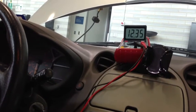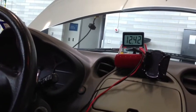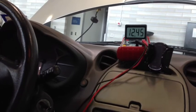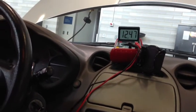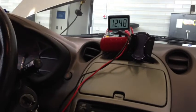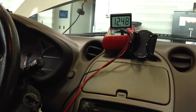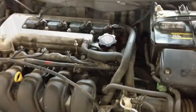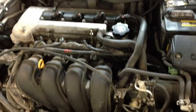That 10.31 volts is the lowest the starter brought the battery down to. A good battery that can crank the engine without draining itself too much should read between 10 to 11.5 volts. On an older vehicle — prior to 2003 — if it goes below 9.6 volts, we have a bad battery. On a newer vehicle — 2003 or newer — if it goes below 10.6 volts, the battery is not able to crank the car without killing itself. This brings us to the end of part one — be sure to look for part two on my channel and subscribe for the electrical diagnosis.